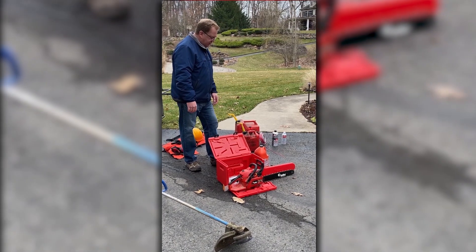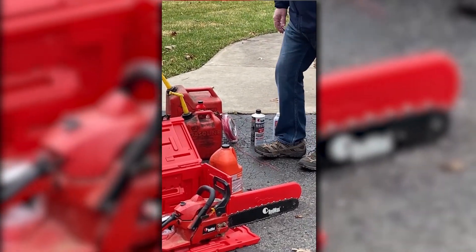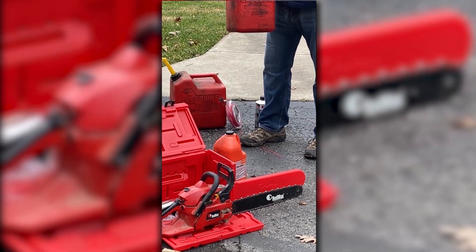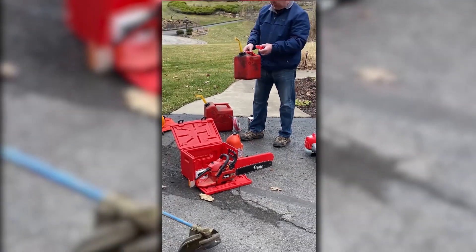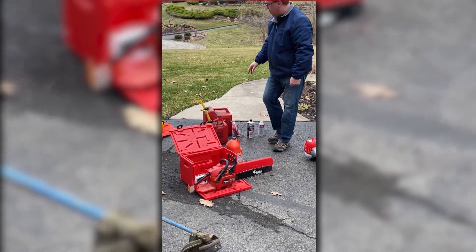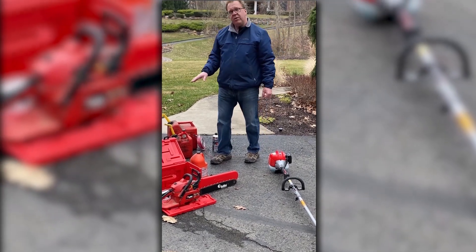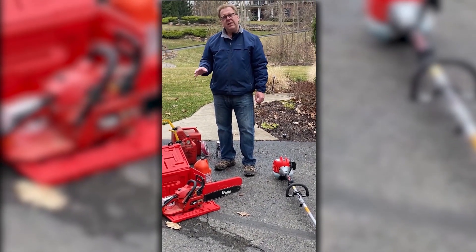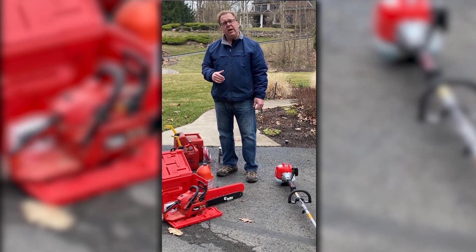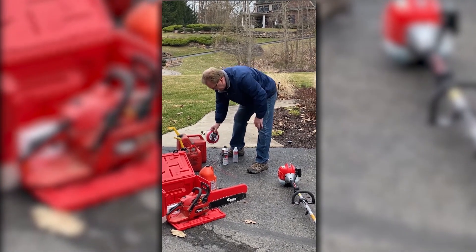Also take a look at your extra products. Make sure you've got bar and chain oil, so when you get ready to use your chainsaw, you have some fresh gas mixed for both your two-cycle and your four-cycle — mowers, lawn tractors, and zero turns. On the gas note, make sure it's fresh gas, 10% ethanol or less. Going with a mid-grade or premium is always the best bet on these small engines. And make sure you've got some trimmer line on hand.